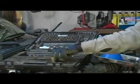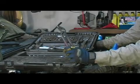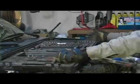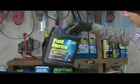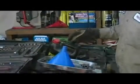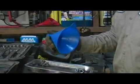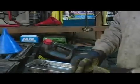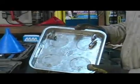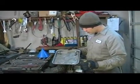I also have a pair of channel locks. This is for removal of permanent tension spring-loaded hose clamps. I, of course, have some coolant in case we need to top off our radiator after service. A funnel, try and stay as environmentally friendly as possible, keep spillage to a minimum, and a magnetic tray. We're going to put all of our fasteners that we remove in it so we don't lose them to reinstall.